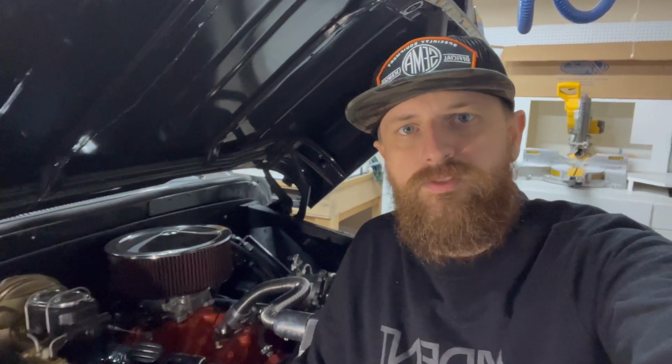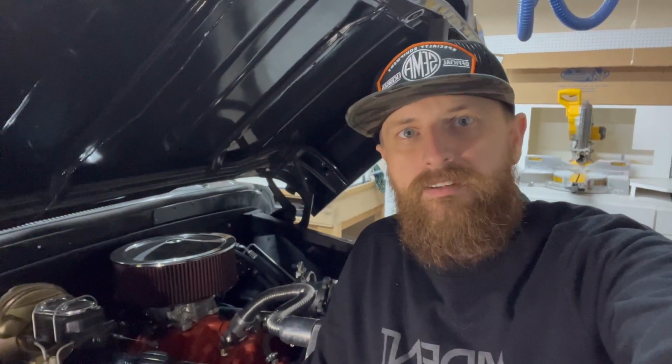So we got the alternator installed. I was checking the amps just with the factory wiring and everything. And as I went up in RPMs, I could see it put me over 3.5 with the compressor running and everything. So I'm excited to see when we get this 4-gauge wire running all the way to the battery, what kind of upgrade that's going to cause.